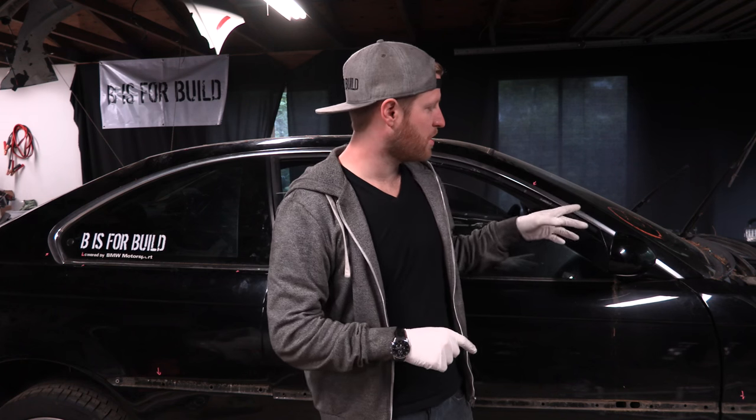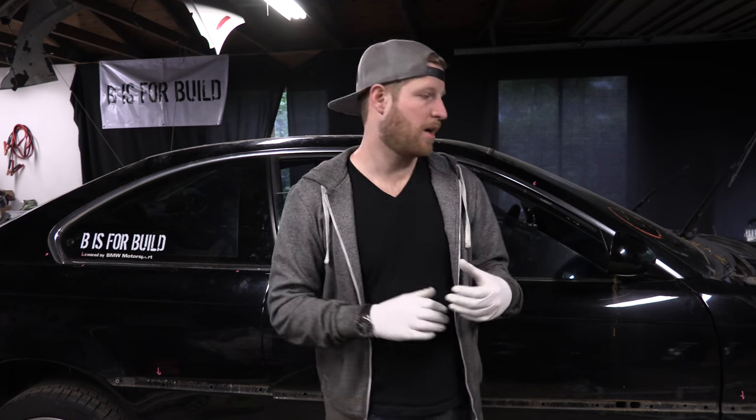We're making alterations to the thermostat thanks to a viewer named Nathan, who sent me a really awesome, very in-depth email and showed us how to hack the thermostat. What we're going to be doing is grounding out the thermostat so it tries to basically stay as open as it possibly can at all times. And we're hoping that'll get the maximum amount of fluid flowing through there. Since we've reduced it, it should help out our cause. So we're going to go ahead and do that all first and then put it through a test run.